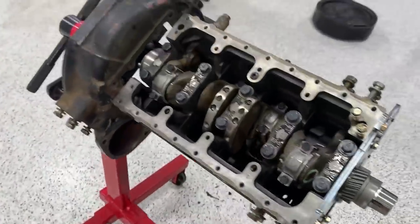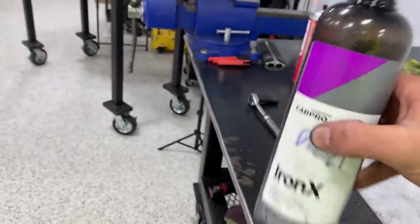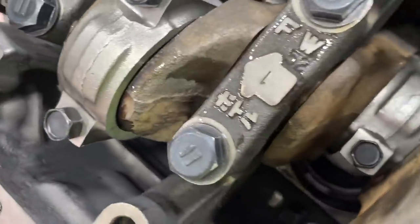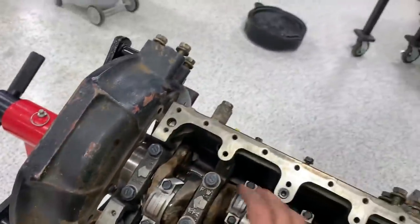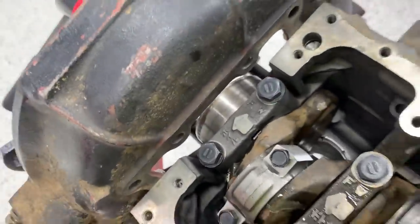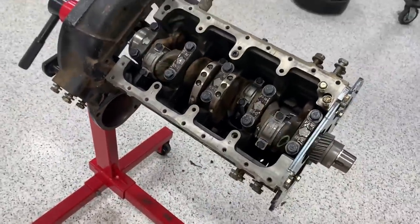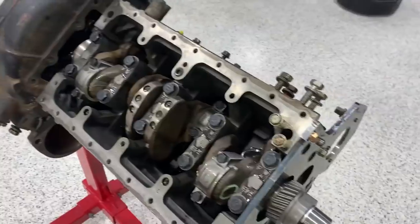24 hours later with the cover installed — that's a stopping point. The last thing I'm doing is spraying the cylinder walls down with straight 15W40. After the honing and brake cleaner, the bare cast iron surfaces start rusting almost immediately — you can actually see surface rust forming. We'll give that a quick mist and pick back up tomorrow.